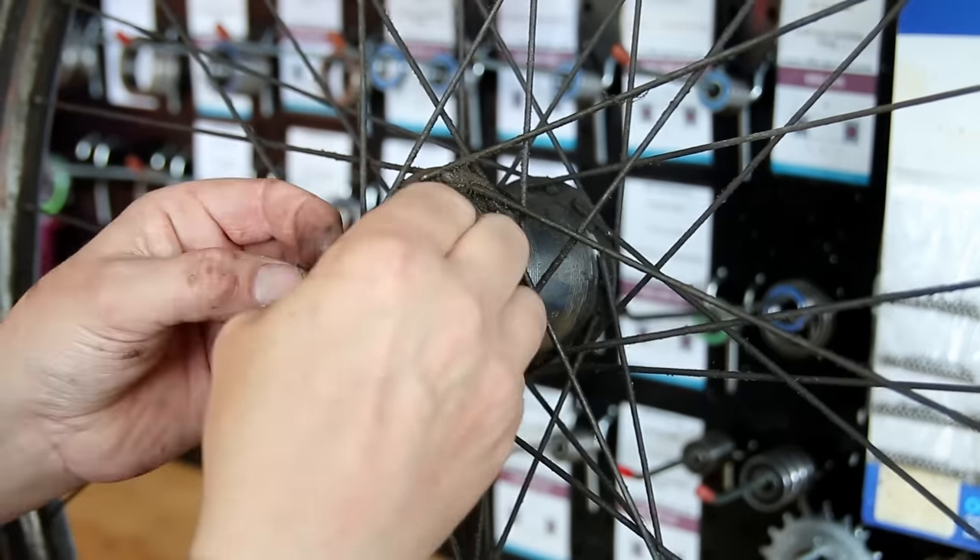On goes the new cable for the rear three-speed Sturmey hub — these cables are still available, so it's good practice to replace them. The old cable was kinked, damaged and rusty and would never have changed gear nicely. Clip off the end, new tail on there — gears working. A couple of cable clips back on the frame to hold the cable. I also noticed the original pump holder was bent out so I straightened that. Gears checked and adjusted — changing perfectly. Brakes checked and working absolutely spot on.